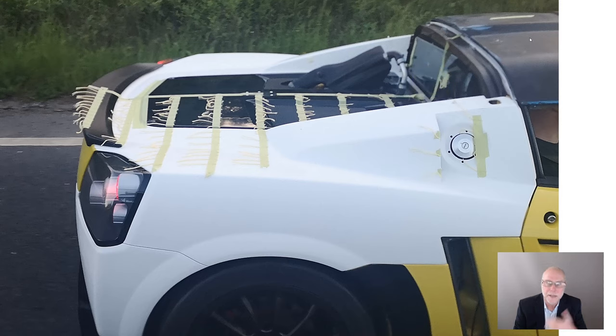And that's because there's a big recirculating bubble occurring. So the airflow comes off here and does a big swirl around like that. And so that's why those tufts are all pointing forwards. All of this is in separated flow. The airflow just starts to reattach here. We can still see there's some separation. Not all the tufts are pointing backwards in nice neat rows. The flow attachment's a little bit better there, but again, not complete. And then we can see here and here, we do have flow reattachment. Closest to the camera here, there's all excellent attached flow.